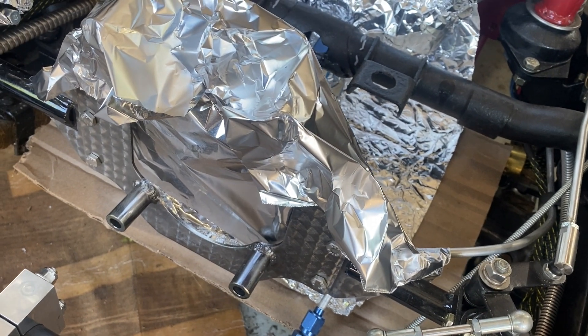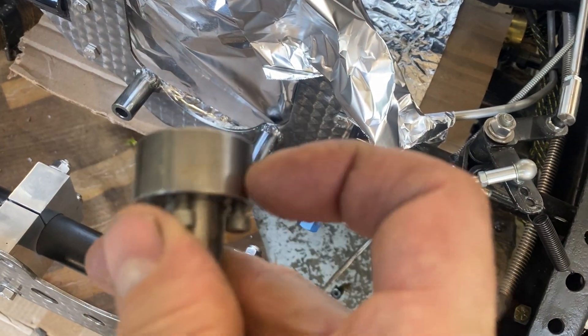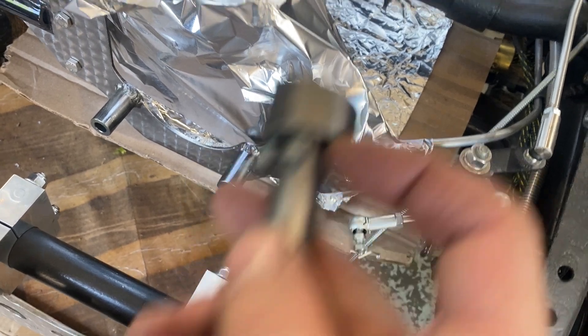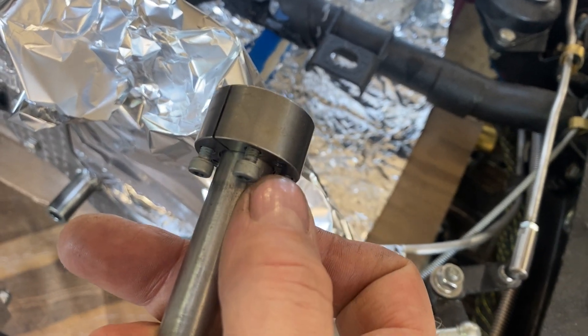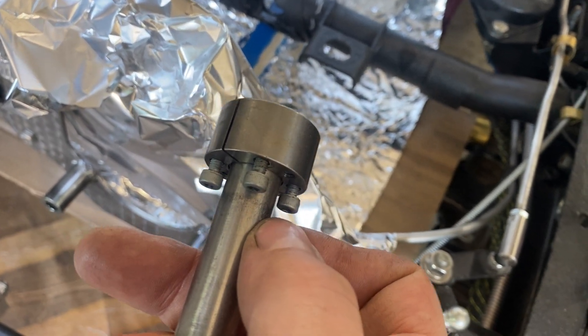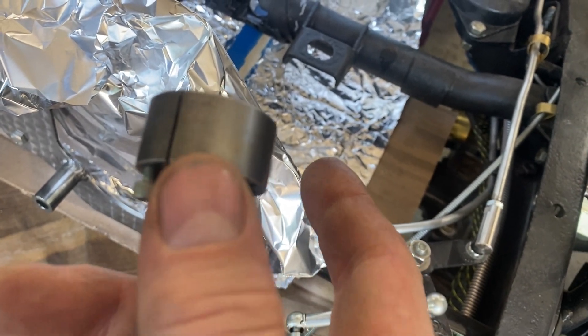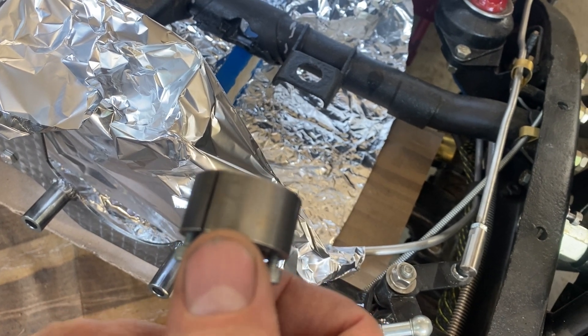Because I had not designed it properly, we had a fracture right here. Right where it came out of this keyless shaft bushing in the crankshaft, it was flexing and worked hard and eventually broke right off. It turns out you have to have two universal joints, because these universal joints don't account for a parallel misalignment, only an angular misalignment.